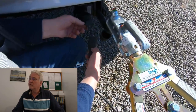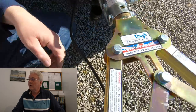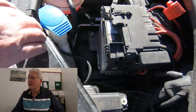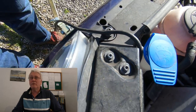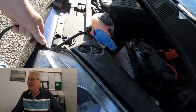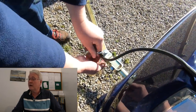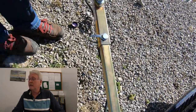Just plugging that in and then you just need to close the bonnet. But you need to make sure you don't trap the cable. So just route it around the little thing that stops your bonnet falling off — I can't think what it's called. Drop the bonnet and it's secure there. Then you clip the cable just under the D clips to make it nice and tidy. Make sure you've got a bit of slack at the front there.